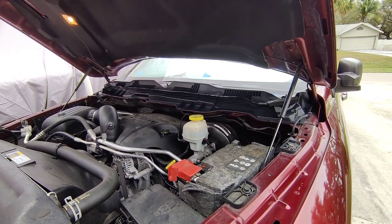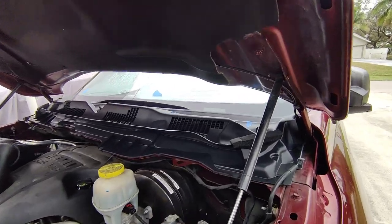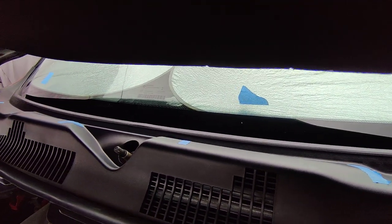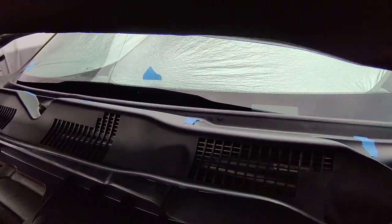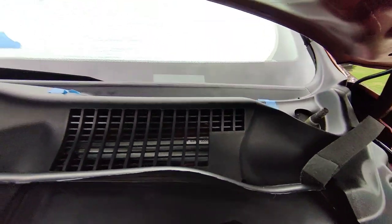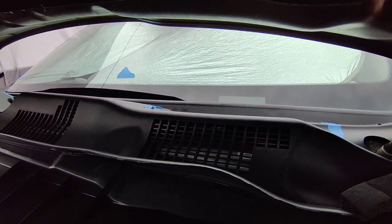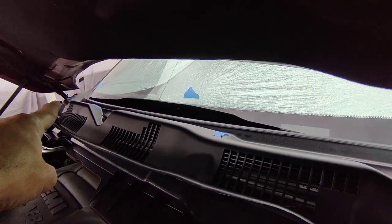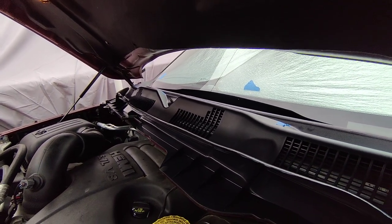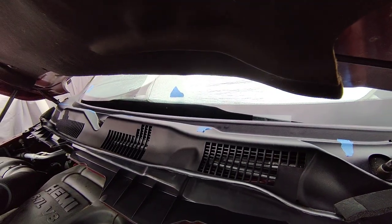Alright, here's the aftermath. It was not as bad as I thought it was going to be. The six clips — I would suggest putting a piece of tape on top where each of them is, that way you know where to look with a flashlight. You can see through the vents. I first installed it and when I was done I peeked in through the vents, and this one here and the same one on the other side, in the same position, had not made it under the windshield — they actually got crushed and curled over. That's why it's helpful to have the tape so you know where to look for them.